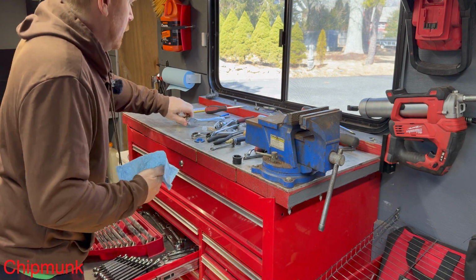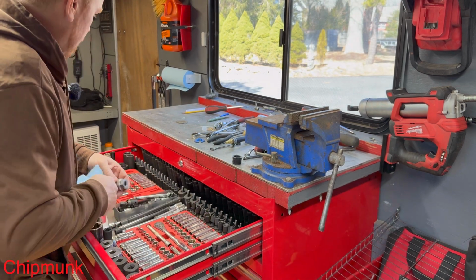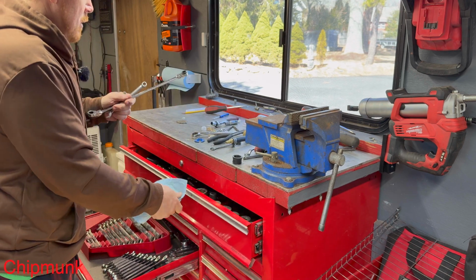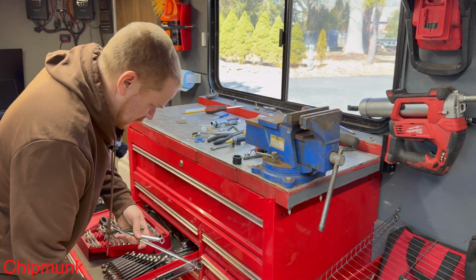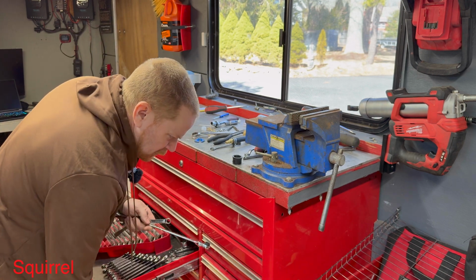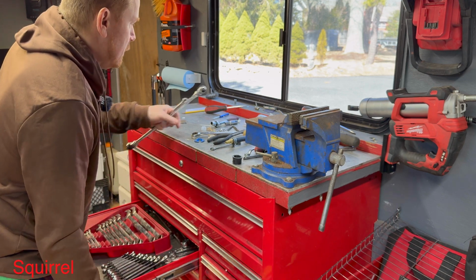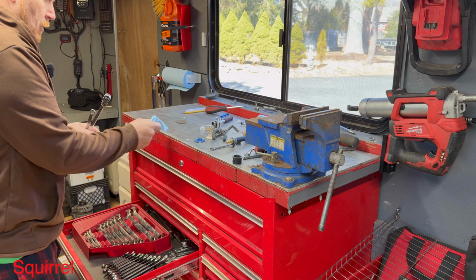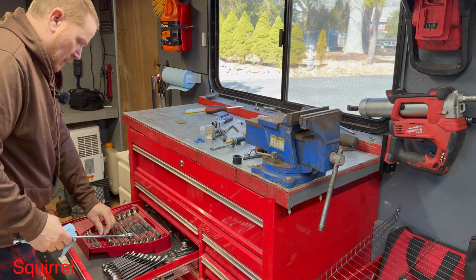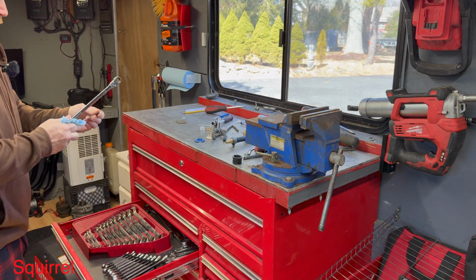Sometimes the oil's a little low and there's a tip sensor, a low oil shutoff type deal, that if the oil pressure gets low or non-existent, it's not reading any oil pressure, it will kill the spark and shut the machine down, which ultimately saves its life, so you don't run it without oil. That's the intention. But unfortunately they can fail too and give you no spark when you really should have spark and work against you. So we're going to investigate all of these things, and I'll show you how to test for them.